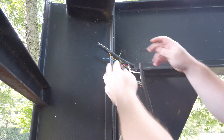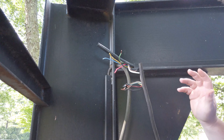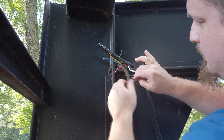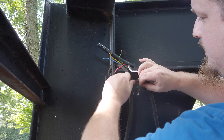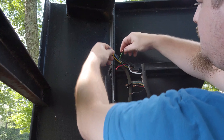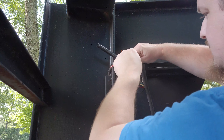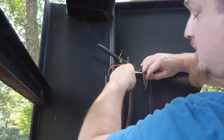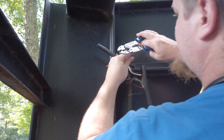If I was super confident I would just go ahead and solder all these up, heat shrink them, shove them in there, and test it afterwards — but I'm not, because of the problems I've had. What I'm really focused on now is getting the brakes to work. I tracked down my wires last night over the brakes and there were a couple of issues there that I fixed. I think the blue wire from my plug — which should be your brake control — should hook up to the red wire, and that should give us trailer brakes.